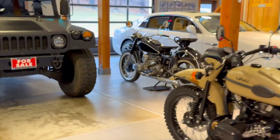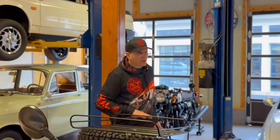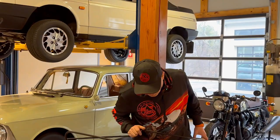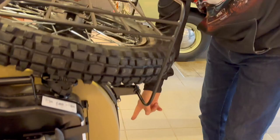If someone does not have the rack or the spare wheel, or they need to make the bike a little shorter — we need to project the back of the sidecar. There's about six to seven inches there, and you also have to account for the grab rail, so you can probably take about six inches off if you didn't have the spare wheel or the rack.